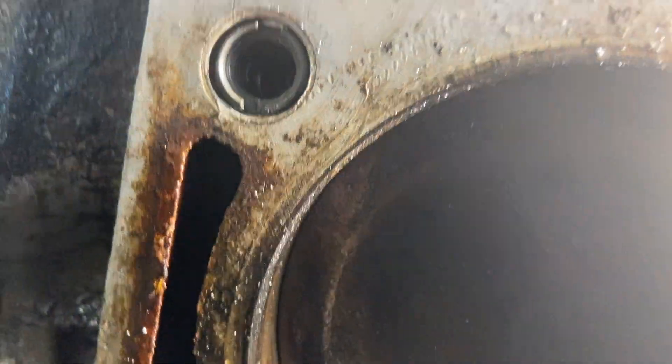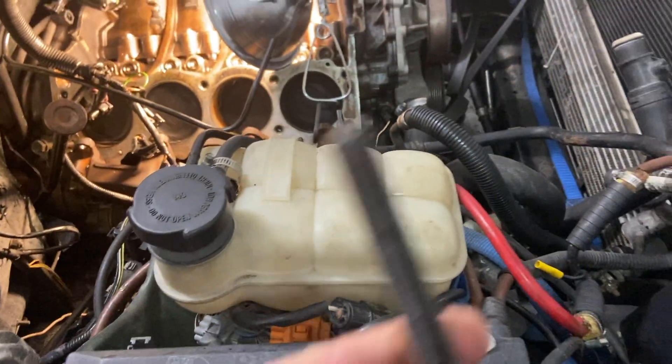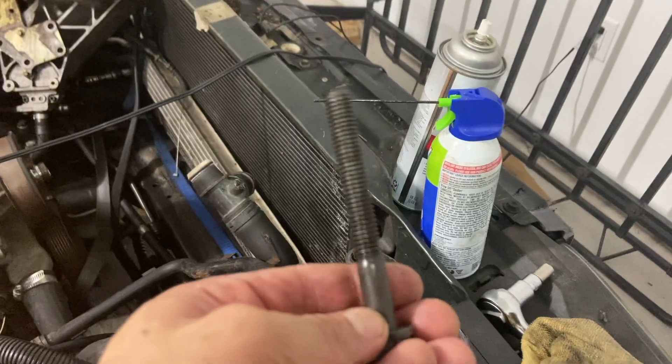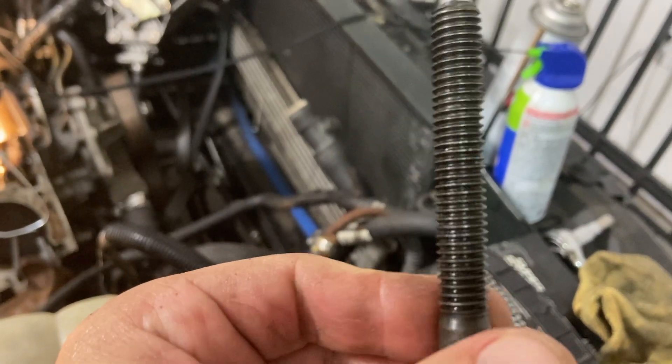Now it's flush — look at that! That was a bolt hole that was stripped and broken, so I couldn't even put a head bolt on it. Now let's pick up one of my head bolts and put it right there. I cleaned it and blew it out with air — air is going to be your best friend when you do things like this. You don't want any dirt getting into the thread.